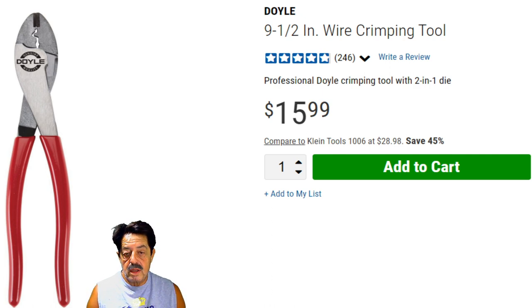Now, I'll discuss with you the pair that I own in a minute, but we're talking about the Doyles. Your question relates to, do I do a lot of crimping? No. When I was doing these trailer flips, any wire connections, terminal connections, I solder them and then I shrink wrap over the top of them. For me, it's just a more professional touch. I think the securement all the way around is better. So that's the way that I do it. If you do it differently, drop it in the comment below.